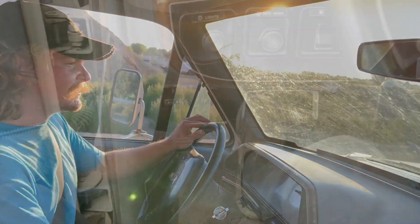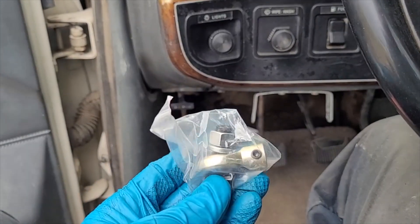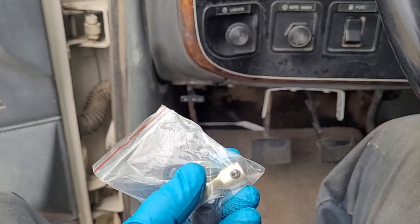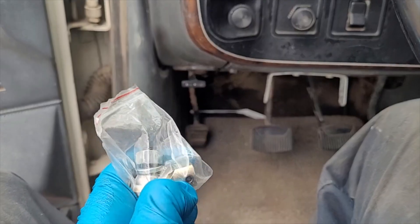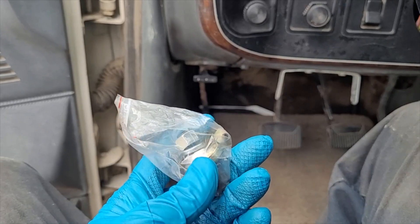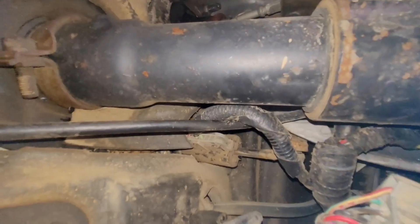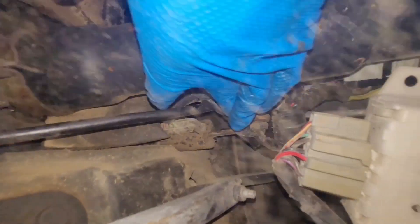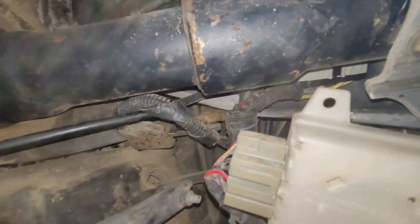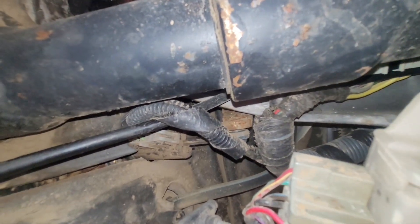I should just not even try. That's all the symptoms we're seeing. So we have this part which the previous owner threw in - it replaces the plastic bushing. You have to cut the end off the master cylinder, slide this on there, and then the grub screw screws into it. So we're gonna get that done right now. Let's start tearing into it. Here is our clutch master.